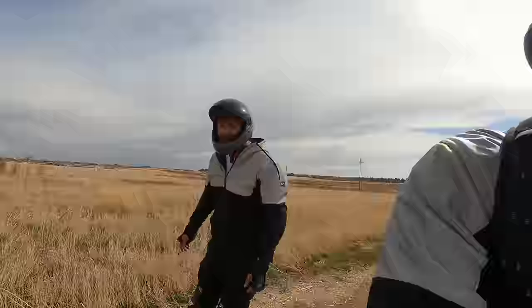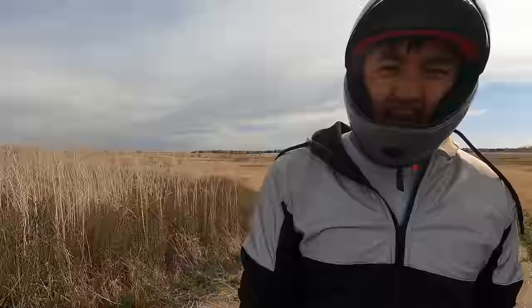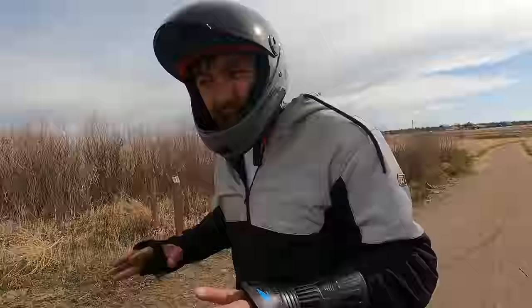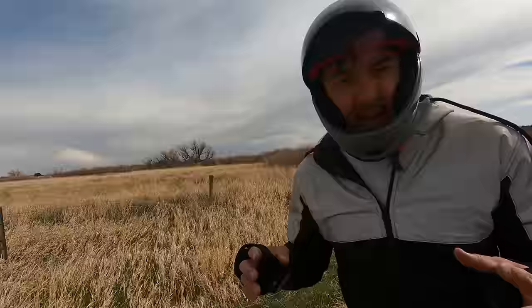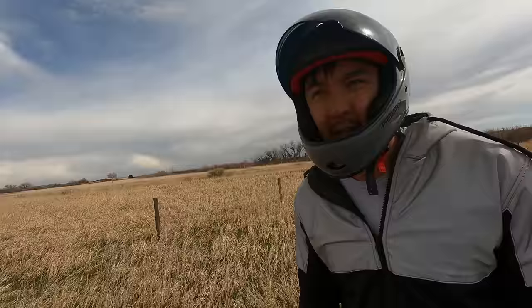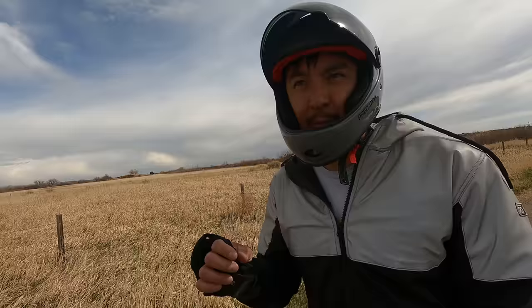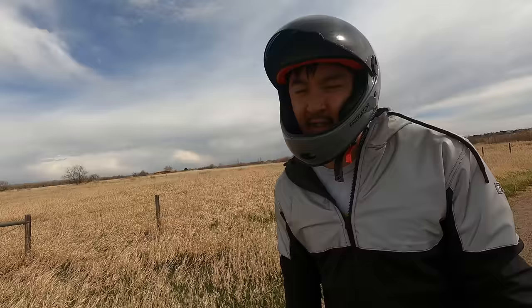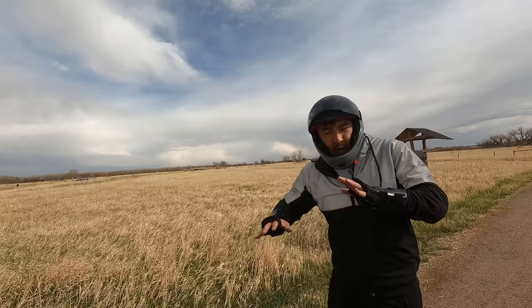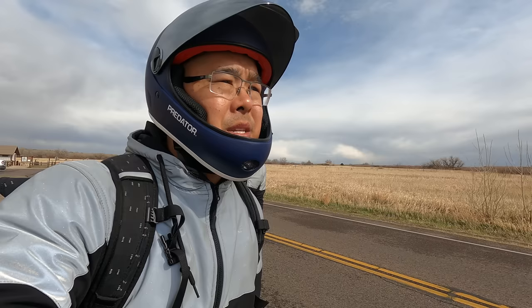Andrew: I love all the new suspension wheels but I do like the KingSong suspension just a little bit more than this one. This suspension is still good but there's a lot to dial in — the rebound adjustment really has a sweet spot depending on what you're trying to do. You really have to adjust it for the type of terrain. You can actually bottom out on slight turns which creates a weird wobbling feeling — this suspension really takes some dialing in and tender loving care.